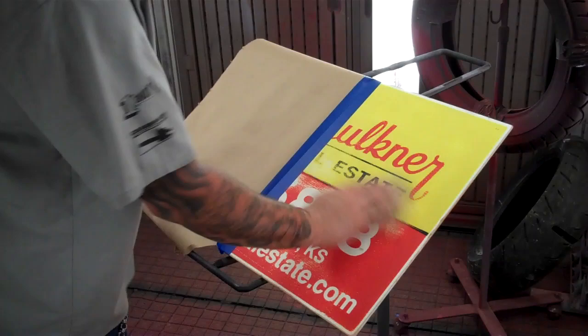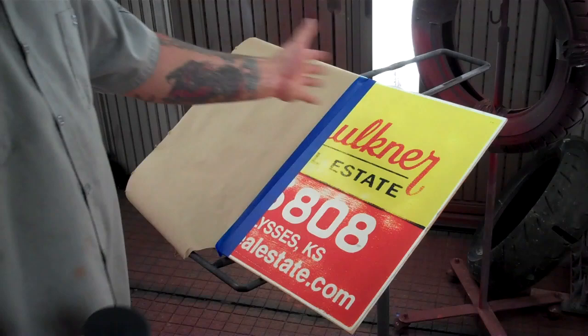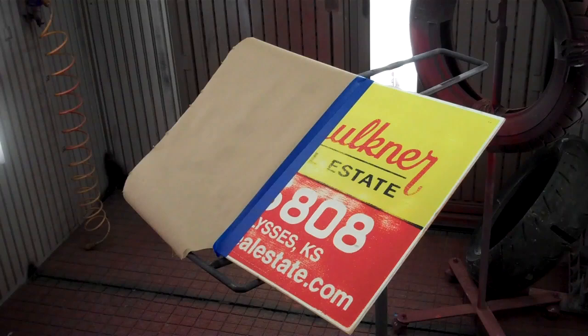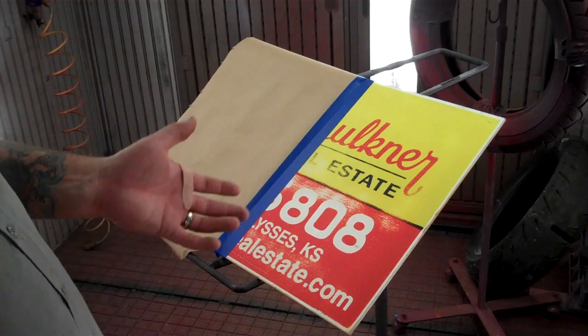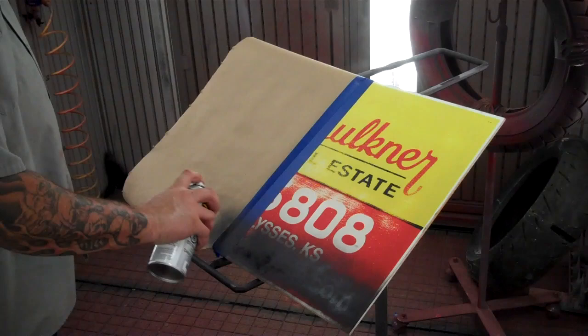The tack rag picks up the fibers from your paper towels. I'm going to do this side with a light coat — this is more of the method to show you how it matches the denim black. I'm turning on my fan; it is hotter than hell in here today — 113 degrees right here in my paint booth. This little plastic shed gets hot but it's good for baking on paint. Light coats, I usually do about three really light coats with about 50% overlap.